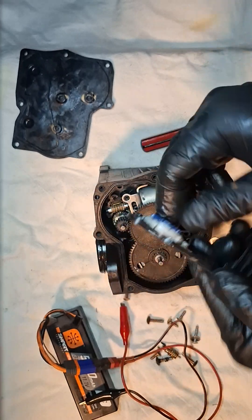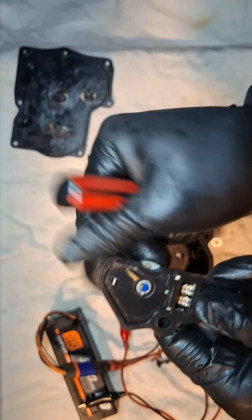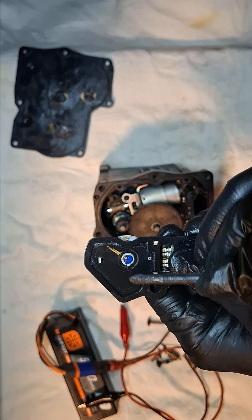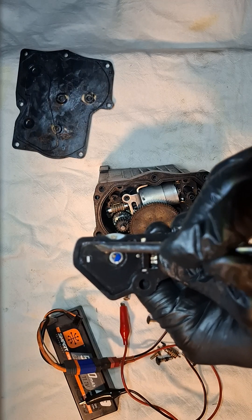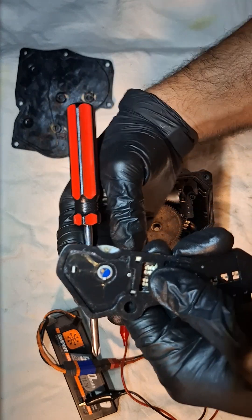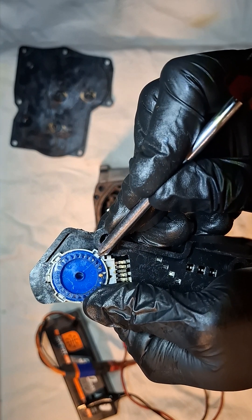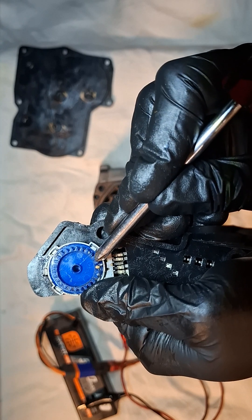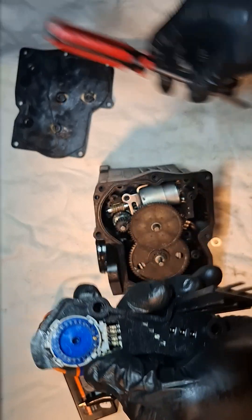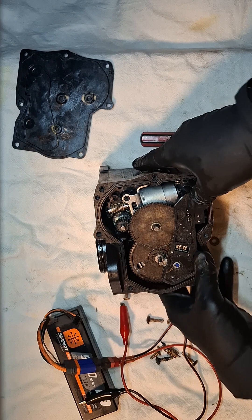Then you bring this gear in, make sure it is aligning, and fit this gear here. Now we come to the last part — this sends the signal to your ECU for the center lock engagement. To calibrate this one: if we look at this one, let's assume this is nine o'clock. You're going to go to one o'clock — here is twelve o'clock, nine o'clock, twelve o'clock, three o'clock. From the bottom, you need to see this line going across the clip, then count three teeth — one, two, three — against this smaller triangle. You need to align the third gear against this triangle.